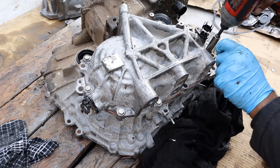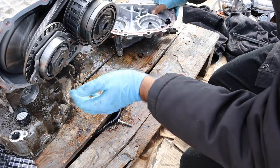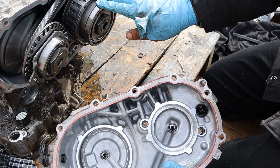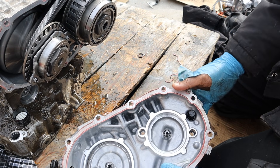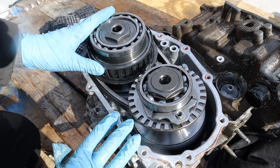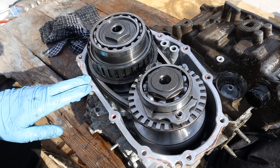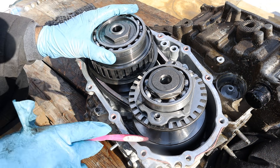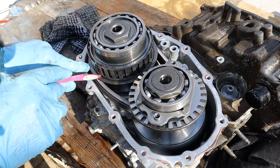With the cover off, you can see here this is where your primary and secondary speed sensors, which govern these variators, are located, as well as these little notches over here that feed the speed sensors. Welcome to the continuously variable transmission. Over here we have our primary variator and here we have our secondary variator. This one comes from the input shaft which is ultimately powered by the engine, and it takes its power through this belt and sends it through the second variator and then down to the output.